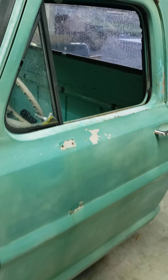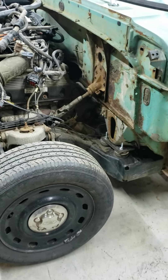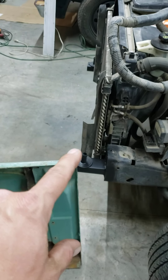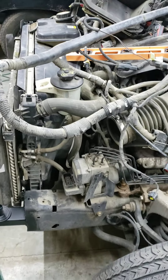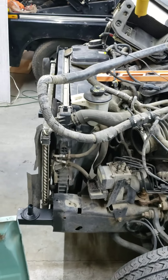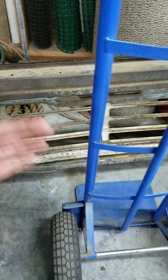We did some work on the Mill Truck since Black Beauty over there has some parts on order — just some connecting stuff, nothing major. Got the steering all together and linked up, got the front all set up for the radiator mount. That's fabbed up and will poke through with a special setup. The radiator's sitting where it needs to sit in the opening, with plenty of clearance between the radiator and engine to work on the serpentine, idlers, tensioners, or any of that. The top of the radiator sits right at the top of that opening.